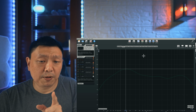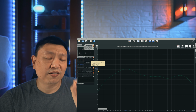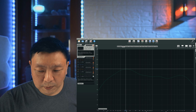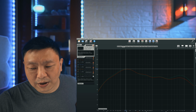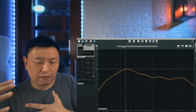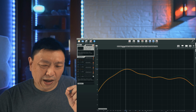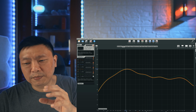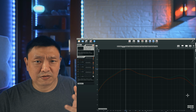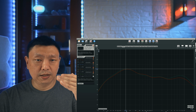Now, this is at 50% volume, and this is without the 360 Reality Audio turned on in the speaker. Now I'm going to load up another curve, and this is the RA curve. So if I highlight the RA curve, you will see that it changes the profile, the sound characteristic of the speaker slightly, and the low end, it loses just a tiny little bit. Maybe the mid-range, you will increase just a little bit, but thereafter, I think after about 700 hertz or so, for most of it, actually, the frequency drops.